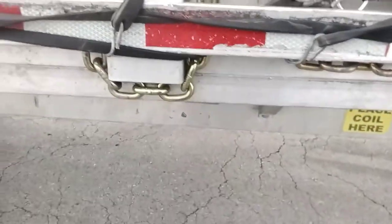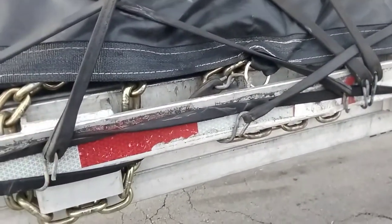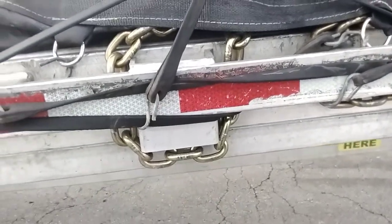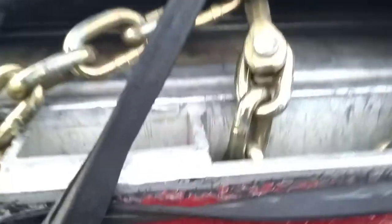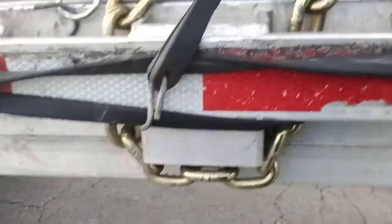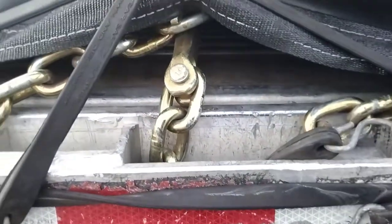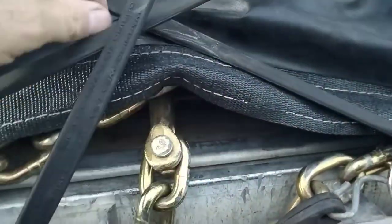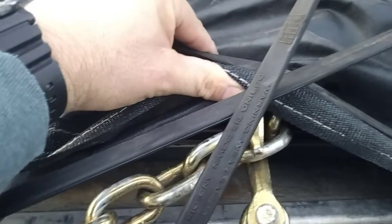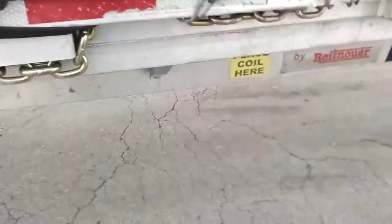Just remember, you lose credit in the DOT's eyes — it's no longer worth 10,000 pounds of securement because it goes to the weakest link, which is 4,000, so it's only worth 8,000 pounds of securement. One other quick tip: I've got my hook pointed up, with the round part of the hook down to the deck. When you're winching them down in close quarters, if the hook is pointed down, you can actually lift it off the chain. Worst case, it pops off while you're doing it and everything goes loose — or worse, you get it almost all the way off, head down the road, hit a bump and it pops loose. That's a bad deal.